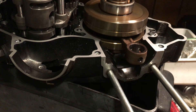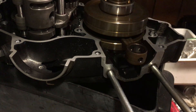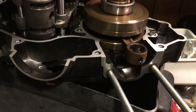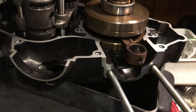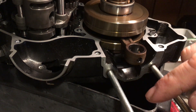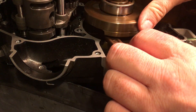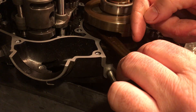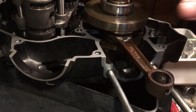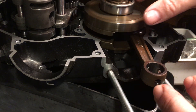That's why this is called a two-stroke — because two strokes happen at the exact same time. It fires every revolution, and that's what makes these things so powerful. They're multitasking. When the piston is coming up to compress the fuel and air mixture already in the chamber, at the same time the bottom part of the piston is sucking in air and fuel. So it's compressed, bang, pushing down.